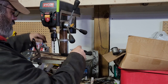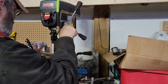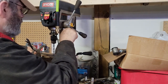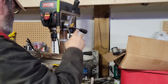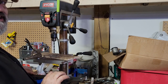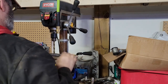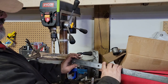So I'm just taking a one-and-a-half flat bar. I already measured out from one of the existing holes in the frame from something that's no longer in use. I have a much bigger drill press but haven't bothered to bring it out — this little Ryobi is a woodworking one and doesn't quite have the power for steel; that's just the belt slipping. Going up to three-eighths so I can put in nutserts. Brand new titanium bit — that should cut through there real good. Now I got two brackets and my holes are actually lining up — look at that, it's a miracle.